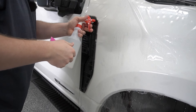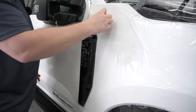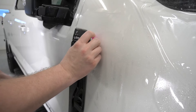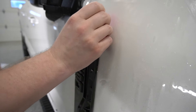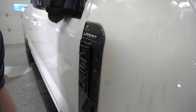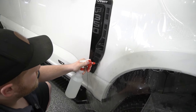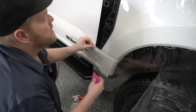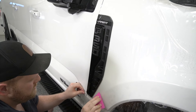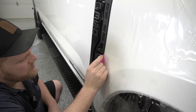Now I'm spraying more tack solution behind the film. I'm taking my finger and hitting it down at an angle — that's going to create smaller fingers which are much more manageable and easy to get into place. Now you can see I've got the PPF sitting nicely in place right around the top of that Lariat trim. I'm going to do that all the way around, top to bottom. Then I'll take my squeegee and press down in that groove by that trim, getting the PPF down in there.